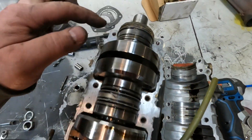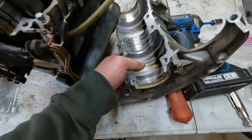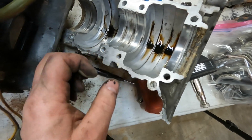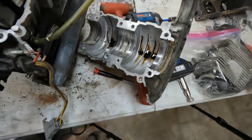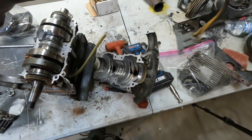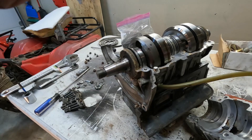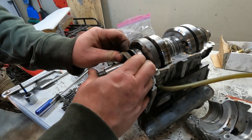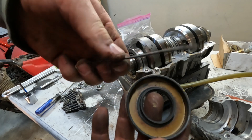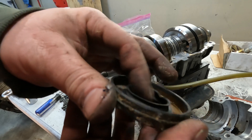There are O-rings on the bearings that you can buy from places like New Breed Parts or Busco Bullet. This is what the case looks like — a little bit of corrosion here where the seal was, but that'll clean up. Usually these crank seals on these Kawasakis are just toast, and this one's no different. Look at that — the spring is right there. That's why you tear these apart, because if you were to run this, the thing would be burnt down with nothing left of it.